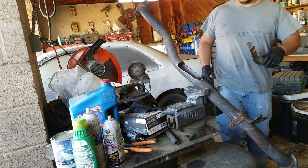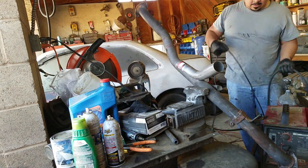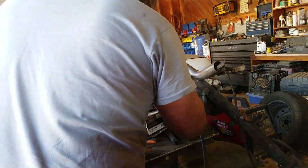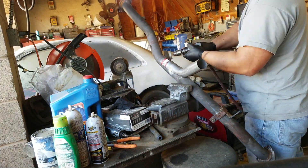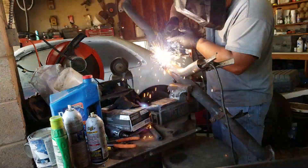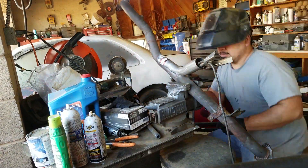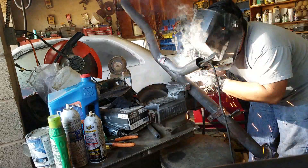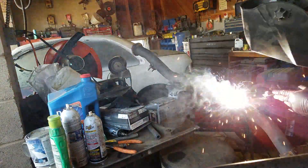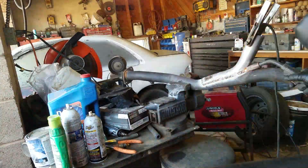It actually took a little more than a day to get all the cuts done and start welding, then day two to get everything installed and lined up. One side note: on the pipe going down, I made it too long the first time so I could cut it back the second time for a perfect fit. I had it on a 90-degree fitting with a reducer from 1¾ inch to 2 inches — the pipe on top is 1¾ inch and the one on the bottom is 2 inches. I welded the converter to the 90, and the converter has a slit cut in it so you can install an exhaust bracket. I test-fit this exhaust probably three or four times, on and off, getting everything lined up.